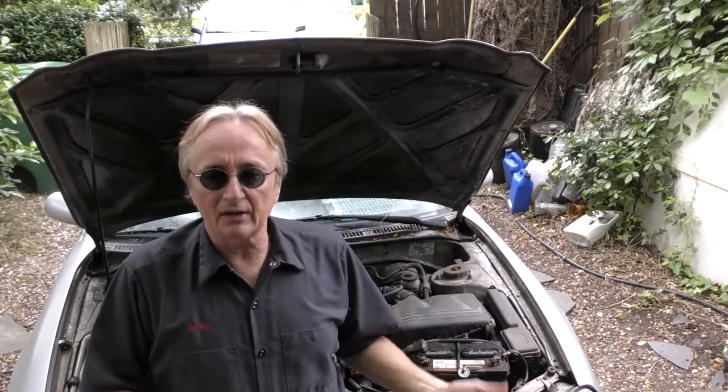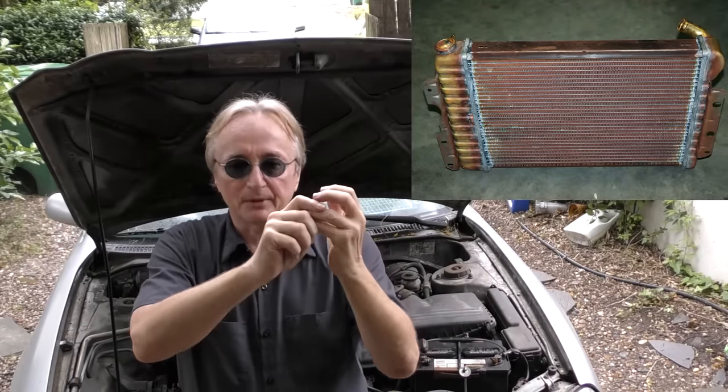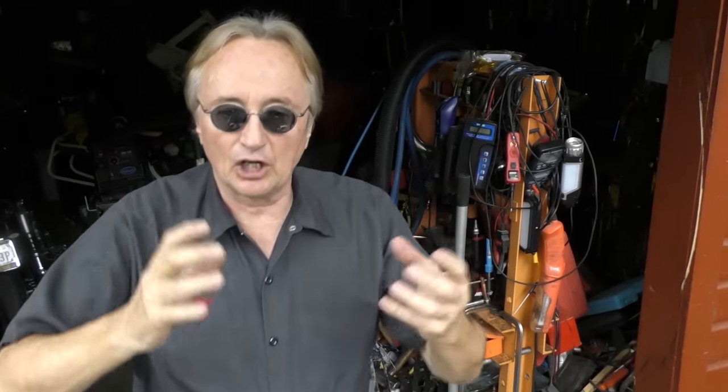When it comes to radiators themselves, here's a tip for modern cars. When I was a young mechanic, radiators were made out of brass and copper — when they got old and dirty, we had acid flushes that could clean all the corrosion out. But modern radiators are made out of plastic and aluminum — lighter weight and much cheaper to manufacture. These radiators don't really flush. When they get corroded inside, pretty much you throw them away and buy another one. Not only are modern radiators aluminum, they have smaller internal passageways. The old ones had big passages that could be cleaned out, but the new ones are so tiny inside that flushing just pushes the crud further in and doesn't often fix it.